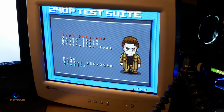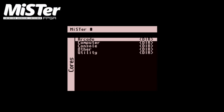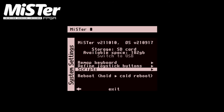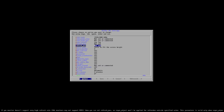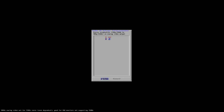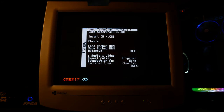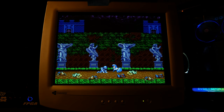There are several ways to get a video signal to your PC CRT, all with various pros and cons that we will cover. Getting started with the first method: scan doubling. It's literally doubling the lines to give you a 30 or 31 kHz signal that the PC CRT monitor can display. In the INI file, we jump down to force scan doubler and enable it. Consumer CRT TVs and a lot of PVMs require a 240p or 480i 15 kHz signal. What we're doing here is just doubling that to give a 480p 31 kHz signal that the PC CRT can interpret.